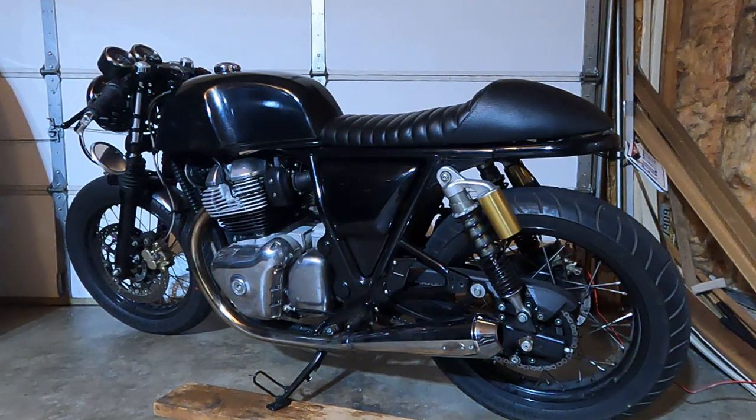And I started riding like I would ride it. I didn't do any highway. I just rode it around my area, the burbs, and back streets, like I would ride it normally. You've got to vary the RPM a lot during the break-in period. You don't want to keep it pegged for a real long time because when you let off the gas, that's when oil comes back up into the cylinder, from what I understand. So you want to do that a lot while you're breaking it in.